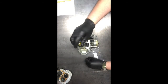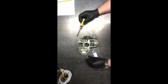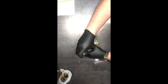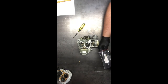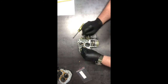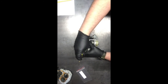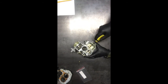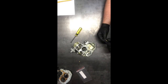Just so I could have a little bit of tunability. Since my stock secondary air jet is a 160, I'm going to take that and put it in my primary. Then I'm going to bump up the secondary to a 180. You don't have to get these very tight — you can strip them out. The primary we're dropping down.